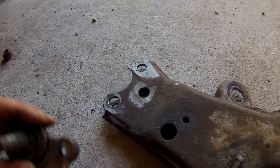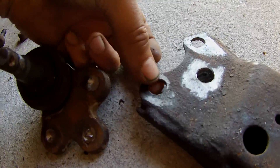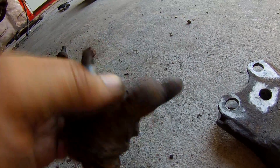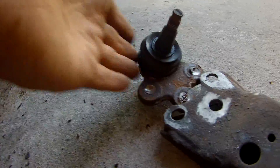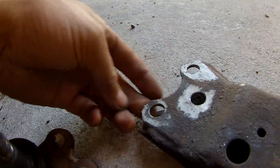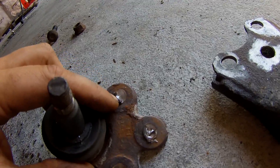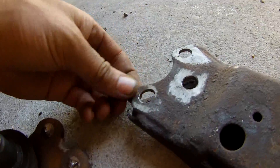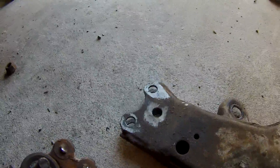I got these drilled out. Basically you just have to drill down the depth of the rivet like I did here — same on the other side. Then you can just bang with a hammer here or on this side and just kind of work it out. These two I had to open up a little bit. I think these were 7/16ths, so I had to open that up to half because the new bolts are half and they wouldn't fit in the 7/16ths hole.